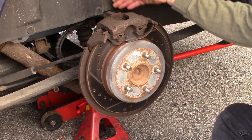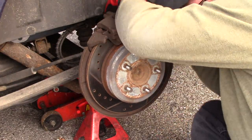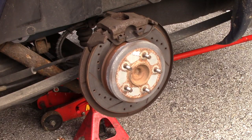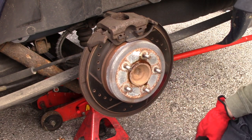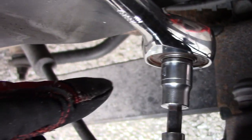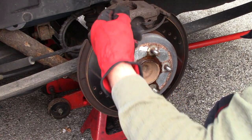There's a bolt on each side — one here and one in the rear — that you're just going to simply loosen. I'm just using my usual PB Blaster here, spraying a little bit around the top and letting it run around. It gets rusted a lot of times and it's hard to break the rotor free. Here are the two screws — one right here and one the wrench is on right here. You could just pull these out and I'm going to grease these in a bit so they slide nice and easy.